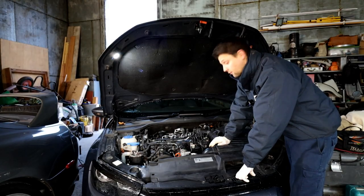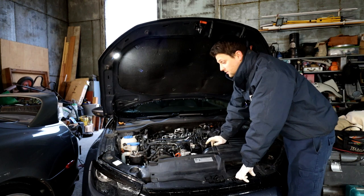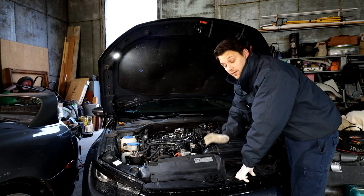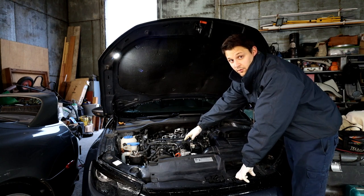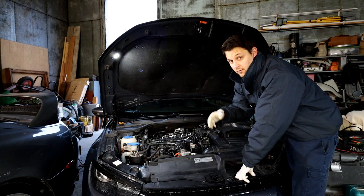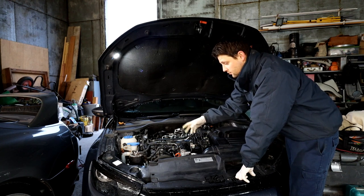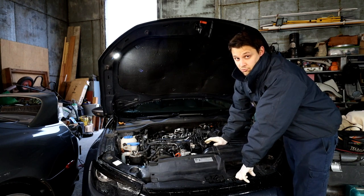I've driven it now for two days and it's all looking good — the spray is still around there. Before doing this job, once you unplug the connectors, if you have access to an airline and air trigger it'll be really handy to blow around the glow plug area and get rid of debris. You don't want anything falling down into the cylinder once the glow plug is out.